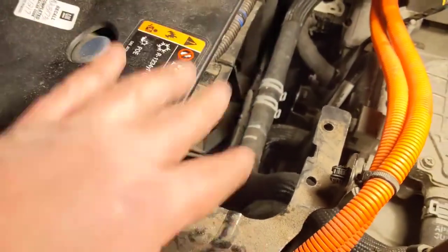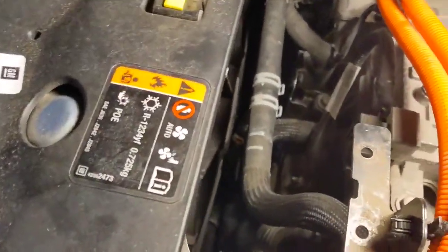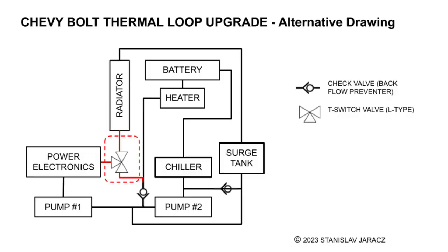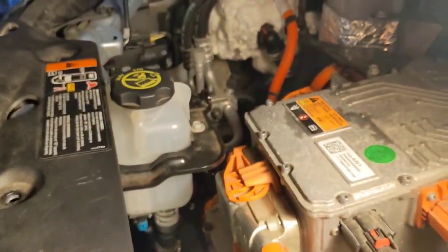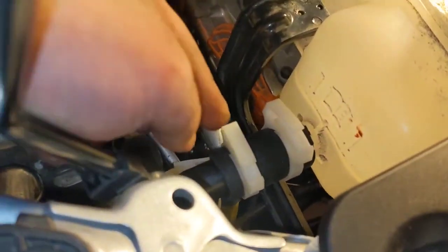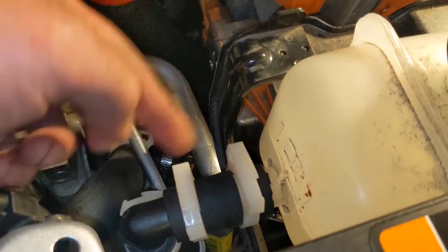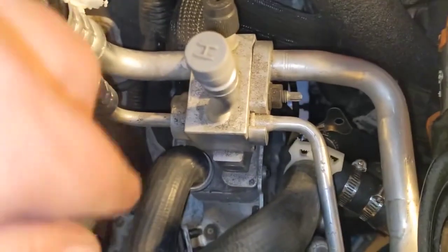Let me take you through the individual parts, starting from the top. This is the place where the original surge tank for the powertrain used to be — it's gone. This cavity will be used to reach down to the valve. This is the valve switching between summer and winter mode — summer is the normal mode. Here is the original surge tank for the battery; it's still empty and I'm going to fill it up shortly. I had to use different clamps here because I ran out. The return to the surge tank is from the upper part of the radiator. And this here is the chiller.